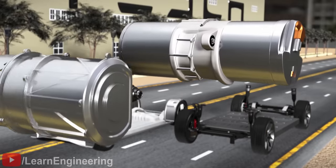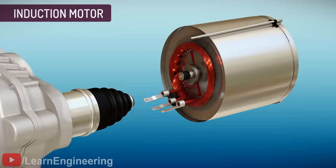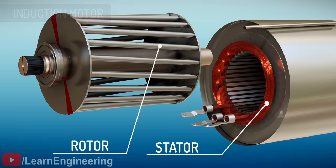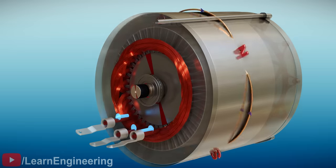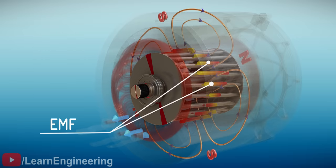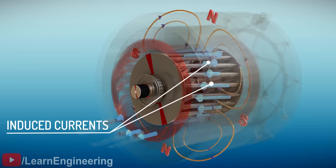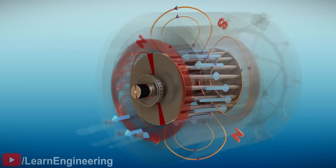To get a clear answer, we first need to understand the Model S's electric motor, which is an induction motor. As you can see, the rotating part here is an arrangement of conducting bars. Alternating currents from the battery packs flow into the motor's outer windings, creating a rotating magnetic field. The fluctuating field interacts with the rotor bars and generates electromotive forces on them, which in turn generates currents in the rotor bars. The interaction between these induced currents and the RMF imposes force on the rotor bars, and the rotor starts to spin.